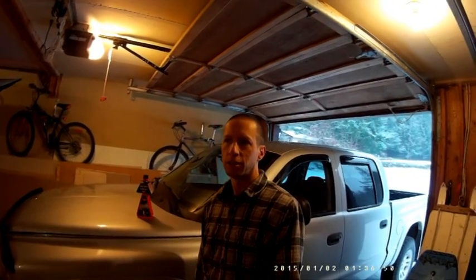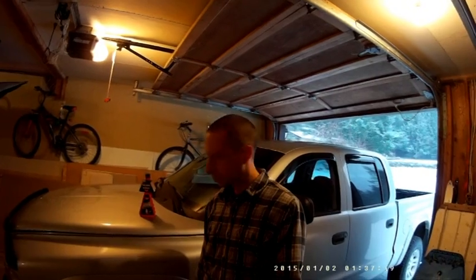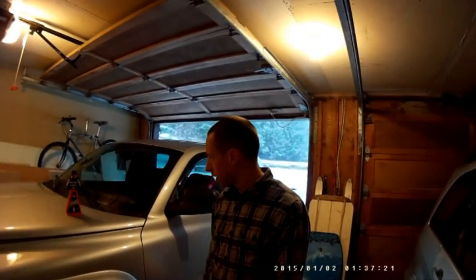In my truck it seems to last about 2 or 3 minutes until the pressure in the lifter comes up, until it touches the rocker again. So I think doing it over and over and over is going to get this Clean Flow engine flush into the lifter itself, and hopefully remove the gunk that's blocking up the little orifice that's stopping the oil from going in. So we're going to give that a go.